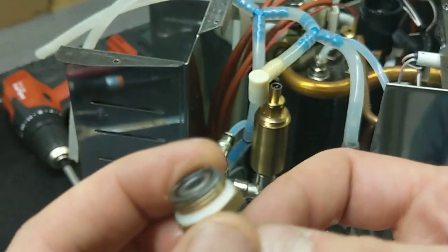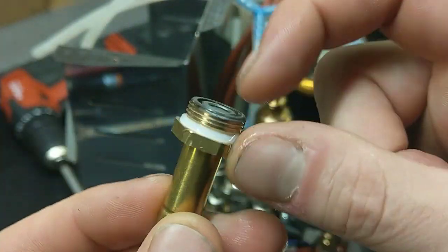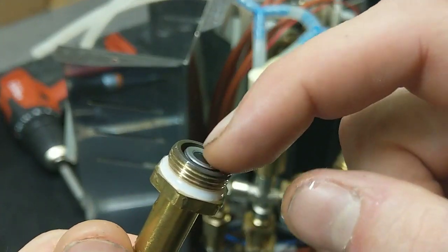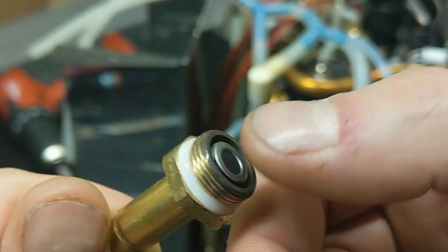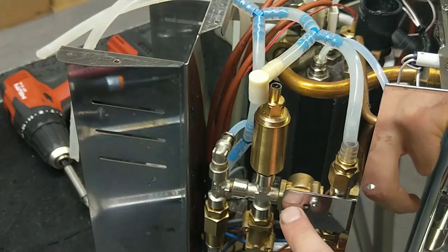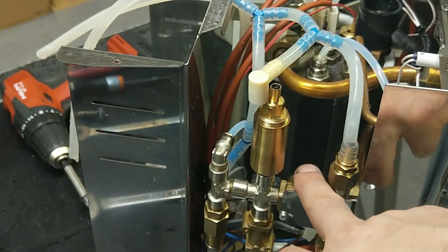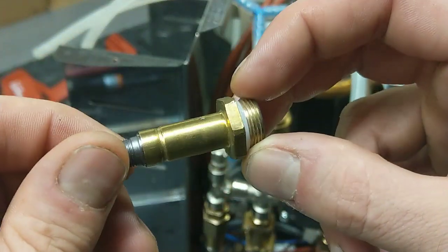As we can see, the nucleus — the piston — is completely locked in position. And practically, the spring — here we have a spring — this spring doesn't work. And I cannot close it; this gasket cannot close the passage. Practically, when we make a coffee, this solenoid valve must be closed. In this case it stays open, because we have a problem in this solenoid valve.